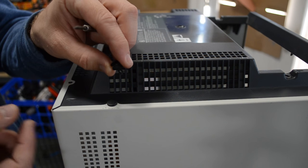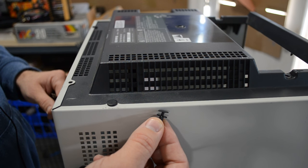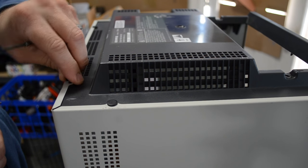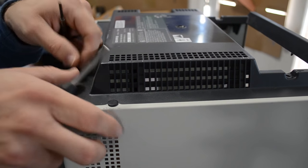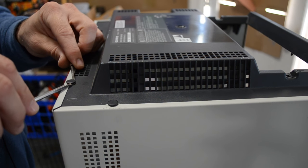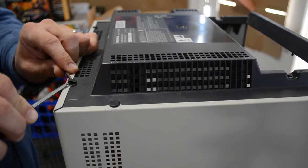There we've got the rivet. Now a tip: if you're going to go back and replace it, just make sure your rivet is open all the way like this, and then simply go back into the hole you took it out of earlier and push it down in there — then you simply pop it back into place to lock it. It's very easy and should be no problem to do this many times if needed.